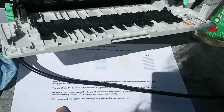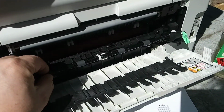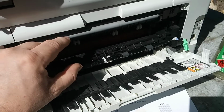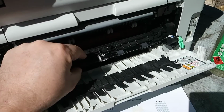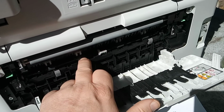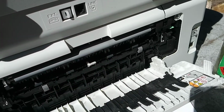producing the wavy pattern at the end, because what's happening is these rollers are working okay. They're pushing the paper, but these rollers up here aren't pushing the paper. So what happens is the paper moves very slowly from this point, but this is still pushing the paper along at the prescribed rate, because these rollers actually heat up from the heat that comes off the fuser rollers.